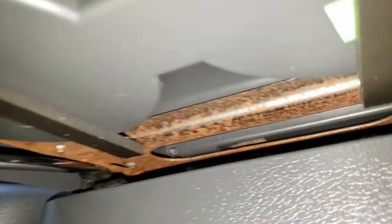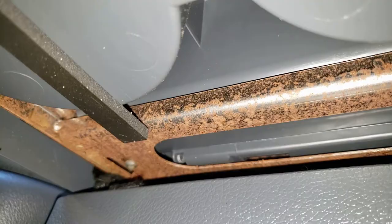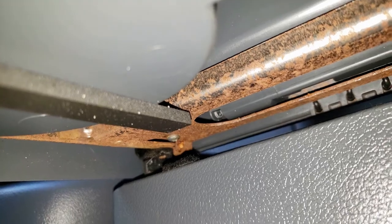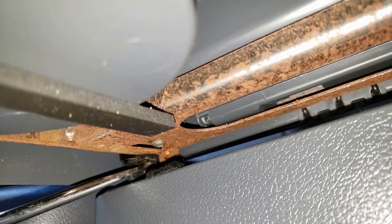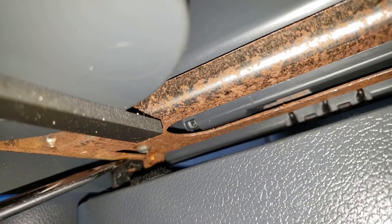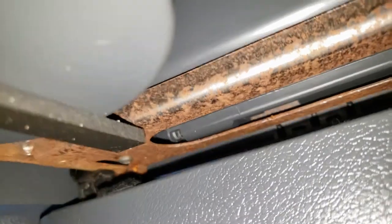I found something interesting. There are two pins that basically stop this drawer. Going all the way forward, you can see this pin here. You should be able to force it upwards, but when it's pulled all the way forward, if you look in there you'll see it's actually a hook — a little metal tab holding it onto the L-bracket on the side. So when it's pushed all the way forward, you can't push that pin back into the body of the unit. You have to release the drawer back in just half an inch.